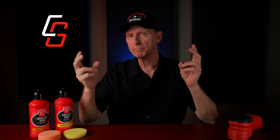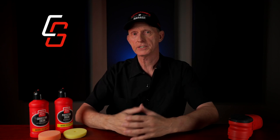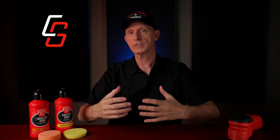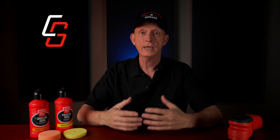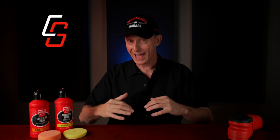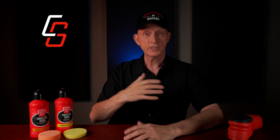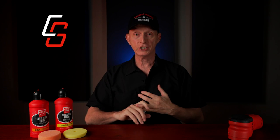So what is paint polishing, or what we sometimes refer to as paint correction? Well, obviously, it's the process of removing imperfections, scratches, swirl marks, and oxidation from your paint's clear coat. Now, you may recall from a previous video that the clear coat is the topmost layer of your paint job. The base coat just underneath that is the layer that contains the pigment or the actual color of your paint, and then below that is the primer. The clear coat is applied at the factory to protect the base coat from UV rays, scratching, fading, and to add high gloss appearance to the paint.